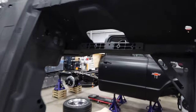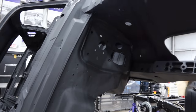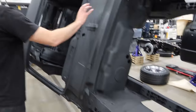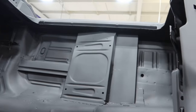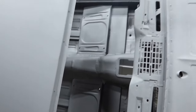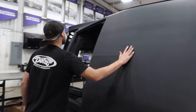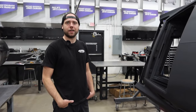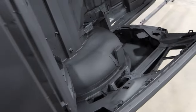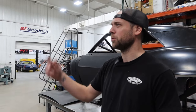We've got the mini tubs in it. On the top side of the Luma frame: modifications for our air intake, electrical pass-throughs, modifications to the brake and steering area, smoothed the firewall, deleted the air intake vents because they're no longer needed with the vintage air. Did what we needed to modify in the floor and overall cleaned up the body — deleted stuff that wasn't needed. The tunnel was widened for that Bowler T56. The modifications necessary to get the updated driveline in it and overall we're really happy with the shape of the body. Really smooth, not a lot of dents or anything to worry about. This car came to us in pretty decent condition — supposedly came out of a container in California. Very little rust, really just needed lining up and gapping. Didn't replace a whole lot of panels — just a trunk, a fender, a door skin, and the rest is all original body panels.